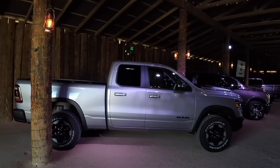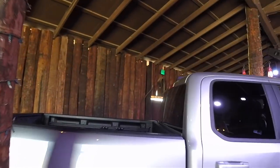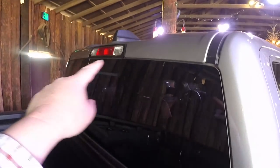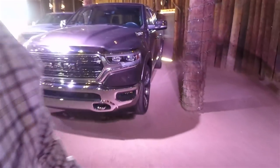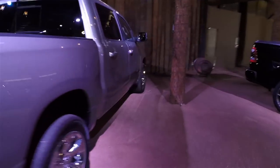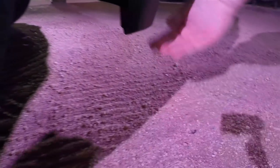Now let's talk about how this thing moves through the air. Keep in mind 357 — and that's not the Magnum, that's the drag coefficient. These trucks have really cool ways to manage airflow. They have a dovetail spoiler up top which improves drag, and on the non-air suspension models they have front air dams that deploy below the front of the truck. Those air dams are built with clutches, so if you hit anything on the road above 35 mph they free up into the body, and when you reset your speed they deploy back down again.